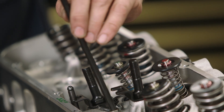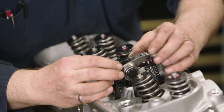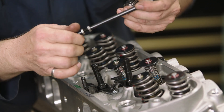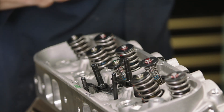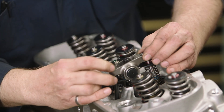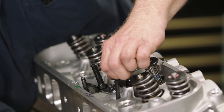So we can do the same thing over here. We'll take this roughly adjusted push rod and we'll make sure that our witness point on the tip of the valve is good. Yeah, it's not too bad — we can make that a little bit longer. That looks pretty good; I'm going to add a little bit more to that. That part of the job is done.